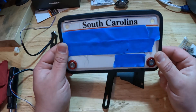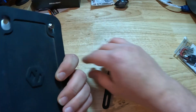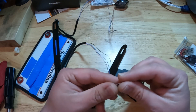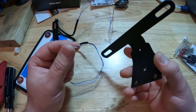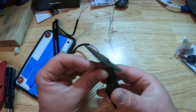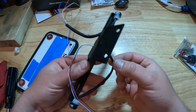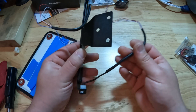Alright, I'm back. Excuse the tape on the plate — I'd rather not be easily tracked down. So first step: I added the PVC tubing and heat shrink. You could run it without it, but it's not going to look very nice with exposed bare wiring. From the bottom portion of the plate, you're going to twist your wires together and feed them through the small hole. I might have left the PVC a little long — let me trim about an inch off of it to make it look a little nicer.